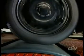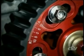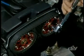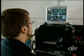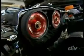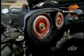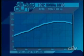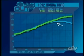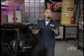The logical progression is to try the intake at 0, plus and minus 2 degrees. Then do the same with the exhaust cam and also work any strong combinations. In the end, our best setup with this engine and cams turned out to be minus 2 degrees on the intake and 0 degrees on the exhaust. At this setting, the engine produced a respectable gain of about 17 horsepower. And instead of peaking at 5,600, the power curve continues all the way to 7,000 RPM. Wow, you can really see the difference some well-designed parts can make.